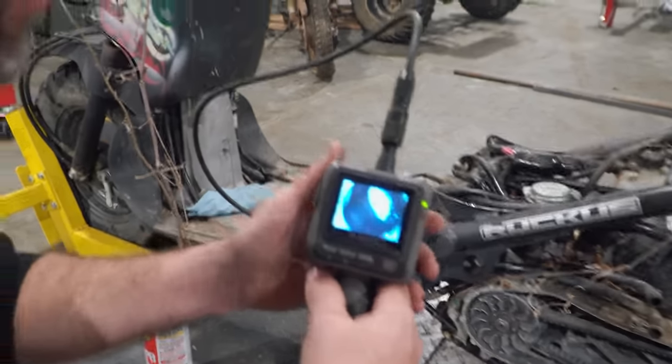We know they're out of spec. We know because I spun it over with the shims in and I had no resistance. Couldn't tell where top dead center is. Taking the shim out, all of a sudden I have resistance. Once I had pressure on my finger, if I would have brought the piston all the way to the top, that would have been top dead center. Okay. I like your way of looking at it without finding timing marks. That's cool.